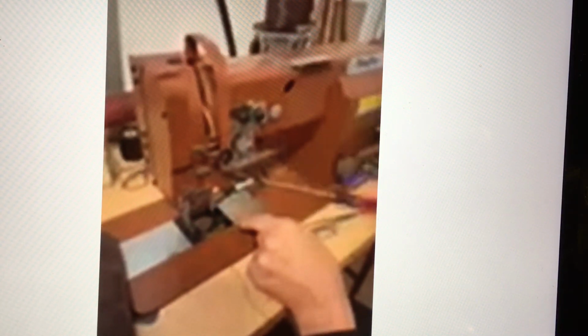And take your brake off, and turn the hand wheel, and you go around, it picks that up, and you'll see it swipe across here. That's when you know the timing, everything's good. Timing rather, not tension, but swing it up through, and then it pops up, and then you put the threads to the rear and start sewing. That's how you thread the top.